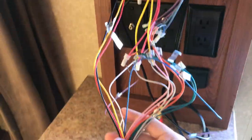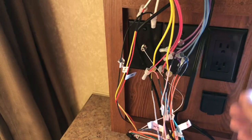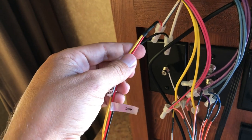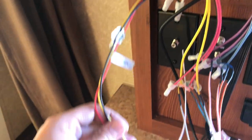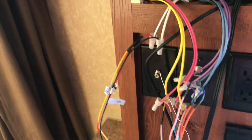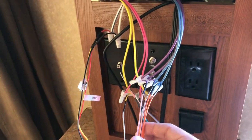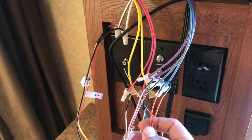The only other thing you have to do is take the wiring harness — it looks like a huge mess, but for anyone familiar with radio wiring, it's fairly straightforward. There's power and ground. In this one you have to do yellow and red to power, because one is like a key ignition which obviously the trailer doesn't have, and the other is constant power to keep the clock and memory lit. Then there's ground. Those two were spliced together using heat shrink tape. There are a total of four speakers in this trailer. Both radios have the capability of three two-speaker sections plus a subwoofer. This trailer is a 21 SSL — it's pretty small. There are two speakers inside, one on each channel, and two speakers outside on channel C.